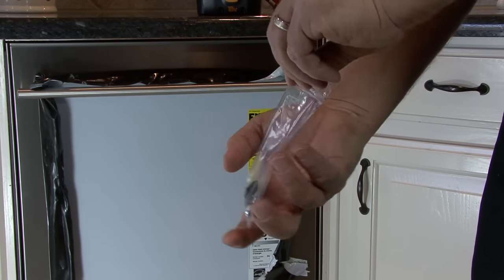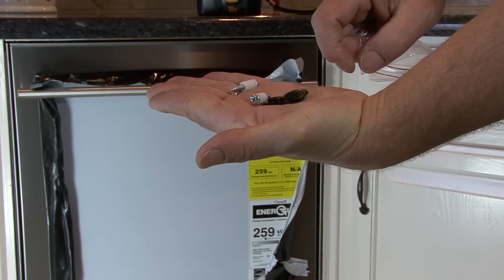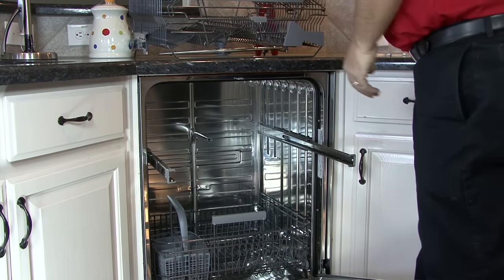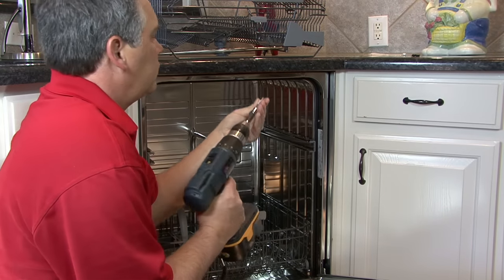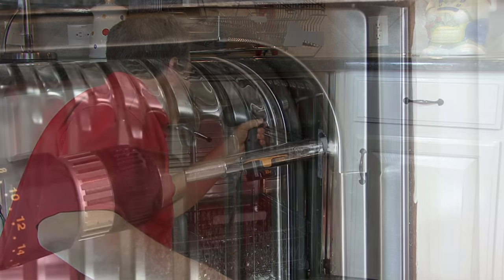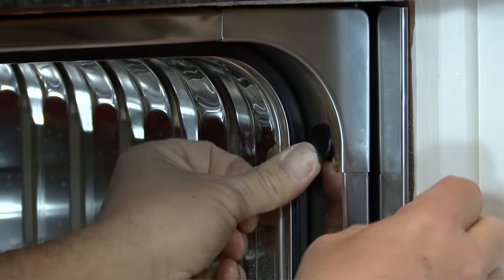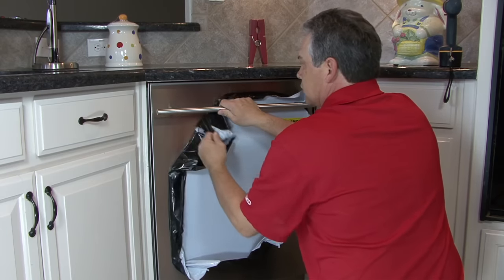Enclosed with the use and care packet you will find a small bag with rubber plugs, two screws, and spacers. Open the door and remove the upper basket — this will make mounting easier. The dishwasher can be mounted to either the side of the cabinet or to the underside of the counter, depending on the countertop surface or the amount of wood available. Using the cordless drill, carefully attach the screw to the cabinet through the hole in the bracket. Apply some lubricant such as liquid soap to coat the rubber plug, then insert it into the hole to cover the screw. Finally, remove the remaining protective cover on the front of the dishwasher.